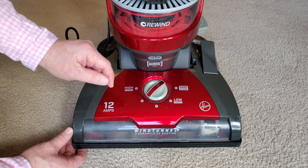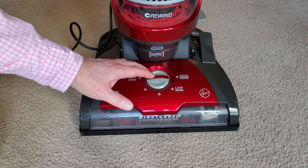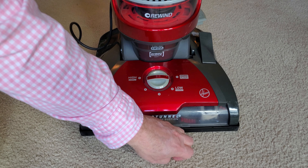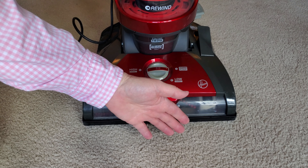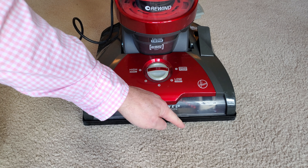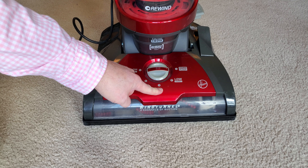Going all the way down creates a huge problem. There's a brush roll, bearings, a belt, and a motor in there. Putting it too far down creates way too much resistance, which heats everything up and wears everything out — including ripping your carpet right out. Will putting it all the way down technically clean better? Yes, but it's like throwing the baby out with the bathwater — you rip your carpet out and blow through machines in no time. If you want your machine and carpet to last, use a proper carpet height.